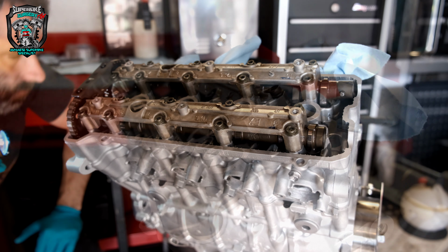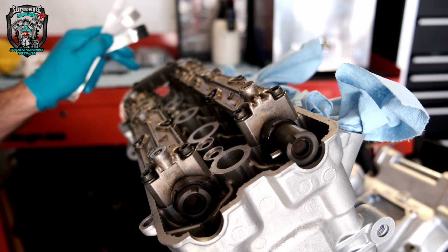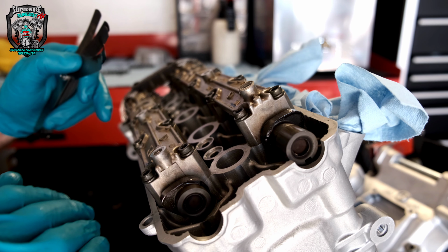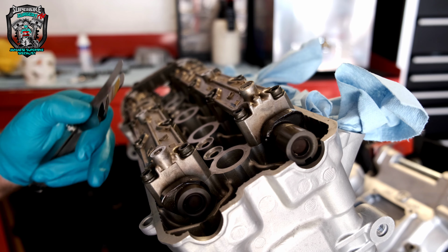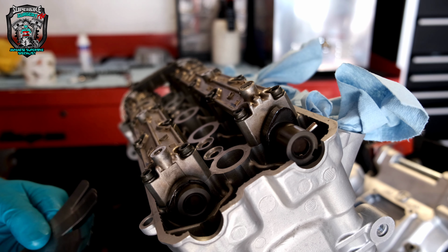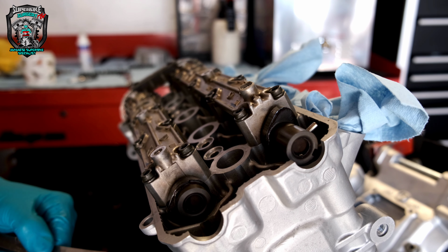Valve clearances next. Right, so checking valve clearances. I don't really want to turn this into a how-to, so I'll just do the inlet side. I'm not getting the engine at TDC on a certain cylinder and doing certain combinations of whatever. I'm just getting the cam in the right position, which is really how you should be doing it. It makes life way more simple. I know why they tell you to do it the other way anyway. Right, so inlet side, 4 to 8 thou, okay?